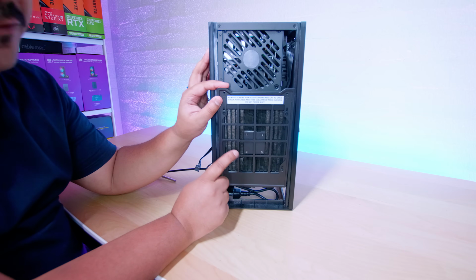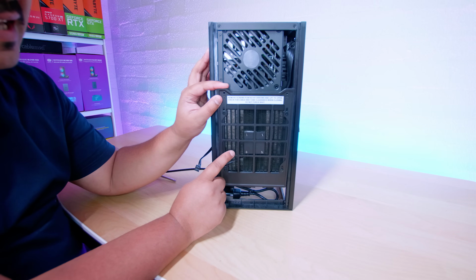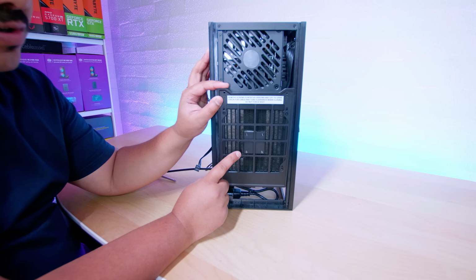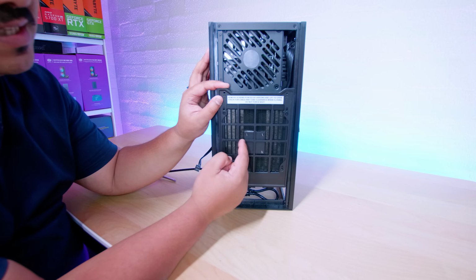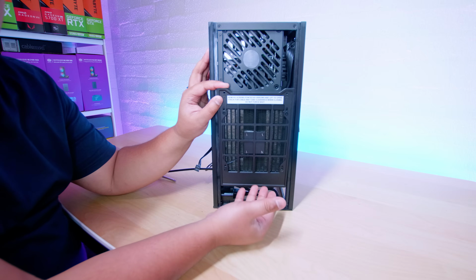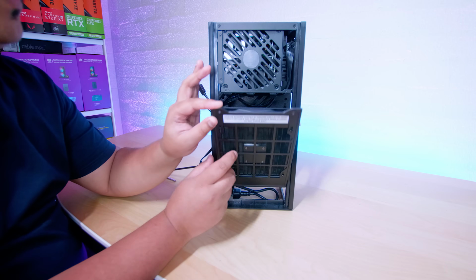It's got a 140mm AIO, and there's one thing that I noticed right out of the gate. It shares the same pump design as the NZXT M22, which in my opinion isn't optimal because you're losing surface space of the radiator with a pump right in the middle of it. So it doesn't make a lot of sense, but we'll see what happens when we actually test it.